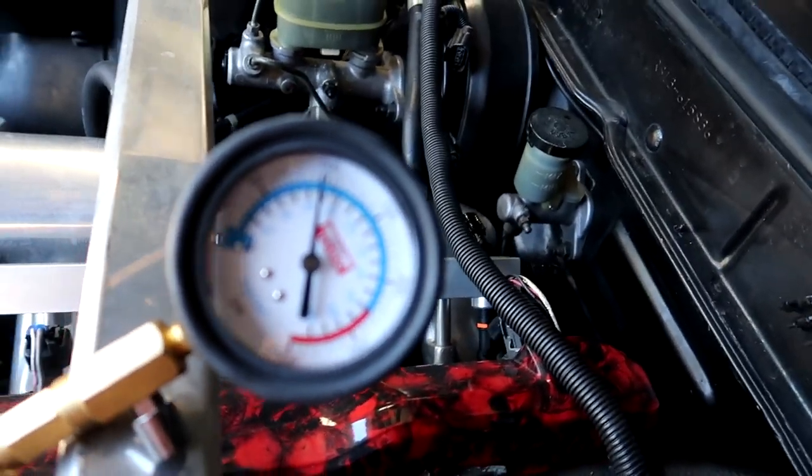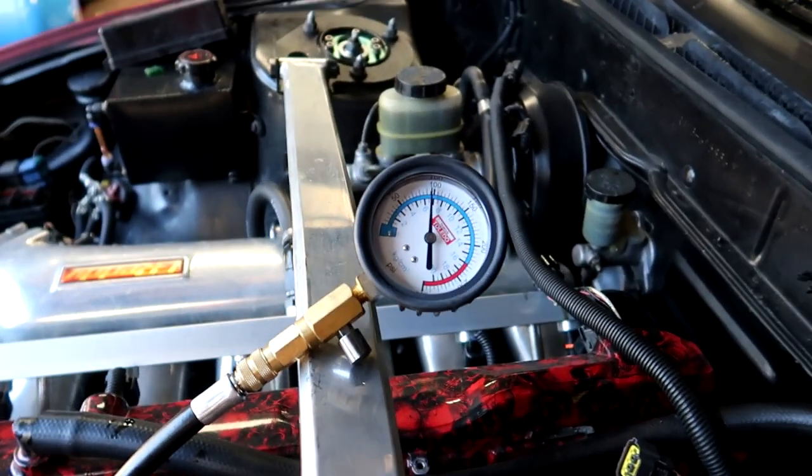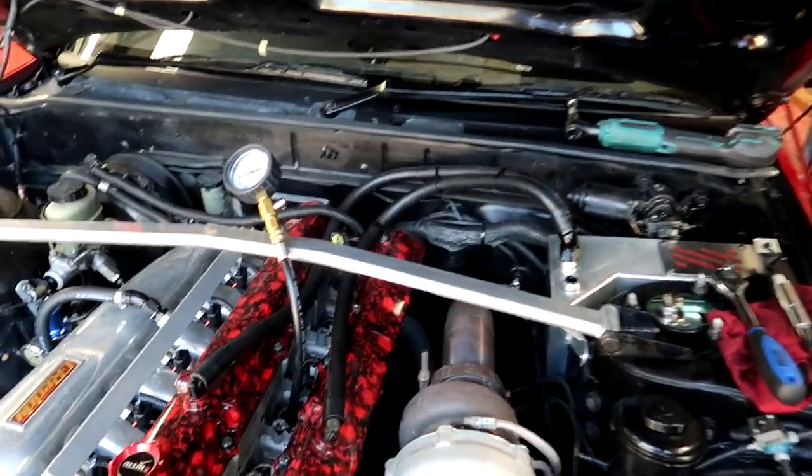So I'm going to retest those other ones and hope something was wrong. If they're all 100 it's alright - not the best but doesn't really make sense. I've just re-tested with the fuel pump disconnected, turning it over a bit longer - it's gone up to 100, which is sick. That was on the one that did 60 before. But then that other low one - cylinder three is on 60. So cylinder three is cooked, it definitely needs a rebuild. My mate Tom loves rebuilding engines - if everyone sends him a message saying can you please rebuild James Nolan's engine he may just do it, I'll put his link in the description.